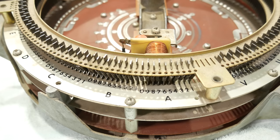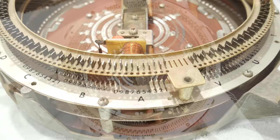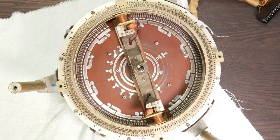Looking now at the top of the selection accumulator, we can see that the bulk of this device is actually empty. We are looking at the top of that printed circuit board that all the wires connected to, and one thing that I want to make clear is that there is no componentry on this board. In fact, calling it a circuit board is a little bit of a misnomer. This is made of the same material as a circuit board, and it has a bunch of wires soldered to it like a circuit board, but those wires are simply connected to contact patches in various shapes. So the bulk of this board is brown and insulated, but we have a ton of differently shaped patches, which are then soldered to the wires underneath.